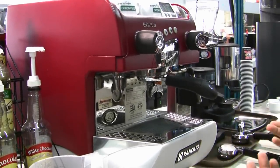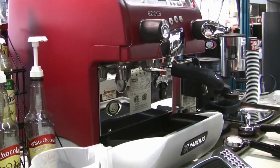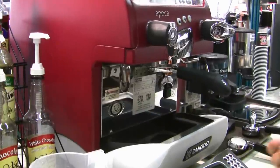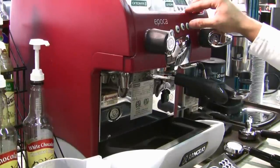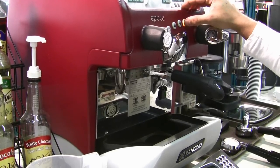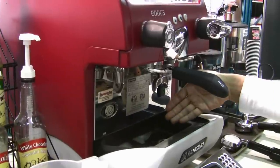The next thing to do is to take off your drip tray cover so you can see what comes out of your unit. The process of back flushing: you want to turn on the pump for about three to five seconds and then turn it off. Repeat that procedure about five times and then let the machine sit. Turn it on, the machine builds up to pressure, and turn it off. You'll notice the detergent come into your drip tray.